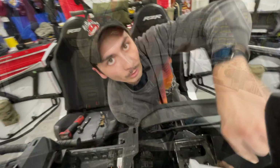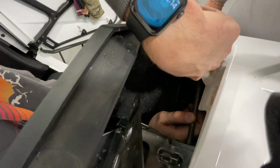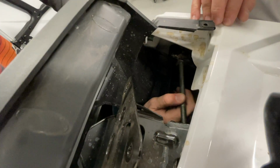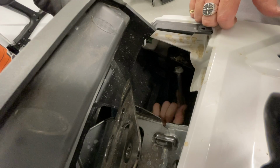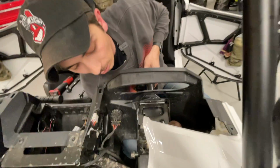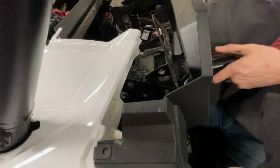All right, so looking down in here where this bolt is coming back, right? If you look, there's this brace, and that's the actual frame of the vehicle, okay? Now this frame of the vehicle, lifting the bolt head over that is going to make it easy to go in, okay? I couldn't really show that on the rear one, but if you come in from under it, you're not going to be able to lift up because it's blocking. So make sure that when you come in, you basically put the bolt head this way, and then you bring it towards the piece that you need to go. And that's especially going to be important on that rear one. I couldn't show that, but I wanted to make sure I did on this one because I noticed that it starts high in there. And then you can see here. And there we go.